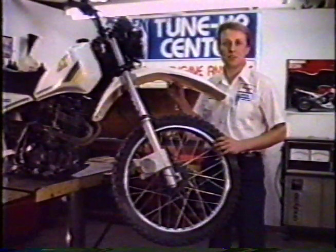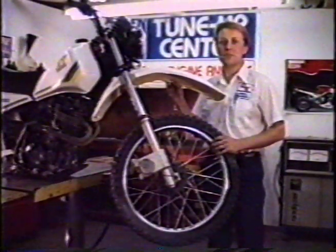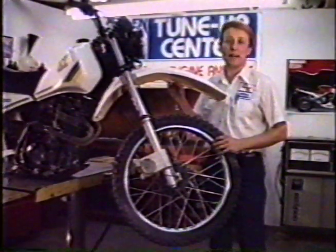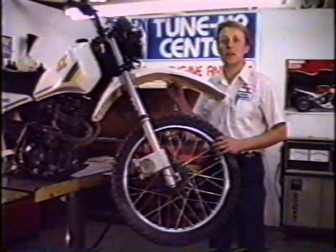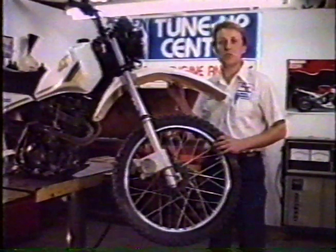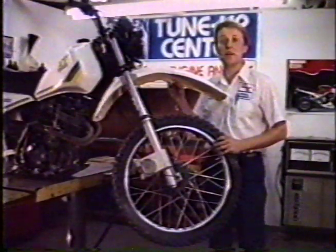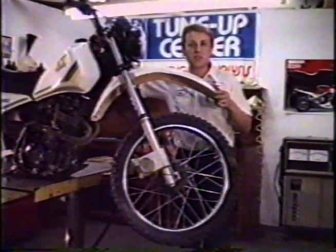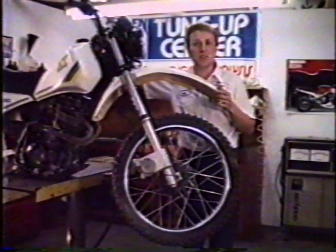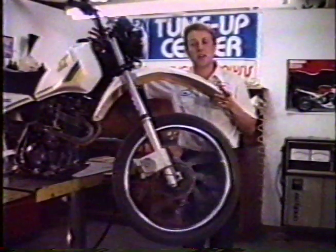Another thing you might be curious about is when to turn your gyro motor on. I normally turn mine on when I'm on the balance point, but when you're first learning, and I do this also when I'm in a tight situation, you can turn the gyro motor on as long as you're going to pull it up in the next second or 2. You may even want to install a mercury switch on your bike so that the wheel only spins when the front wheel's up in the air. I prefer to have positive control of when my gyro motor starts, and for a switch, I simply rewired my turn signal switch, removing the turn signals.